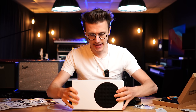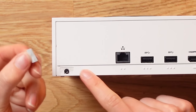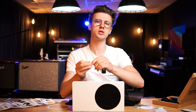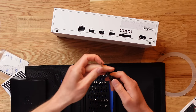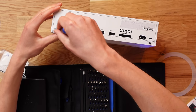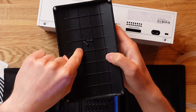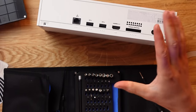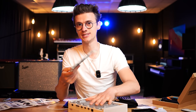The first stage is taking the Xbox Series S apart correctly. Every Xbox will have its exterior screws hidden by little sticky-back plastic covers. As soon as you take these off you will need to heat them up with a heat gun depending on which console you've got — this will void the warranty. Using the iFixit toolkit, try the various attachments to get the right size, then remove the first cover. Use the lid of the iFixit toolkit — it has a checkered grid — to store your screws neatly. The top cover will just slide off, and there's a cool hidden easter egg inside that says 'Hello from Seattle,' which is where Xbox's HQ is.